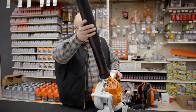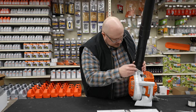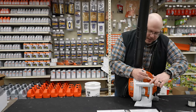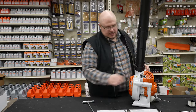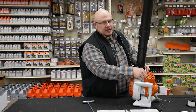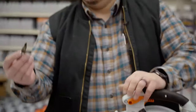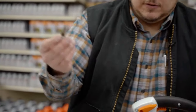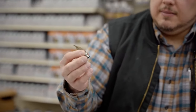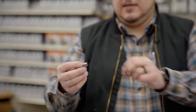On a blower there's not too many other things you're going to have to worry about servicing yourself. The spark arrestor is something I am going to show on this one — it seems to be a little bit more common on blowers, probably because of the amount of debris they put up, which can plug the spark arrestor. I see it more often on blowers than other products. This is what the spark arrestor — or muffler screen — looks like.